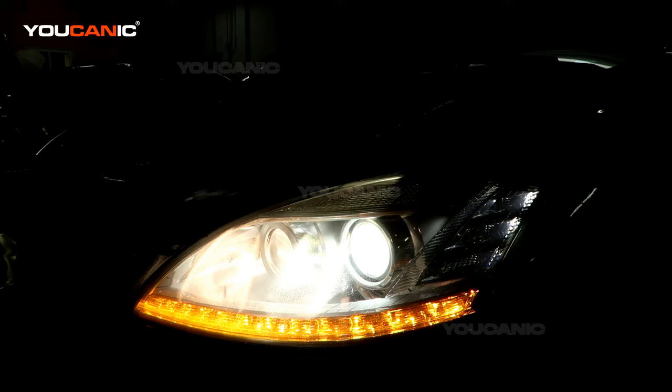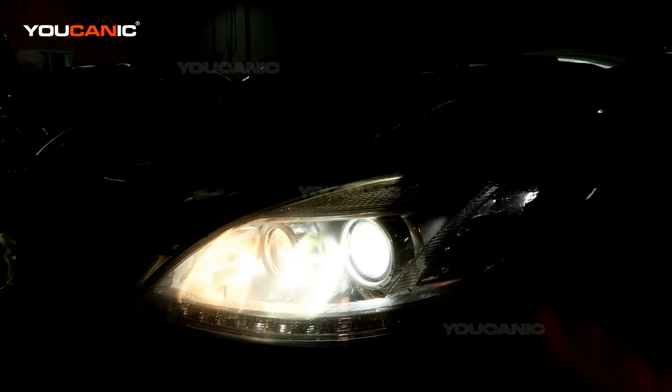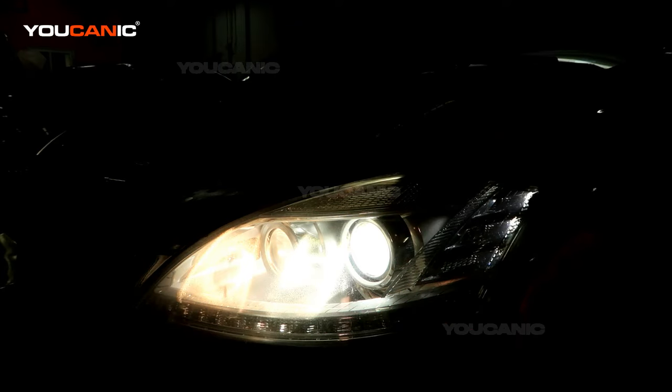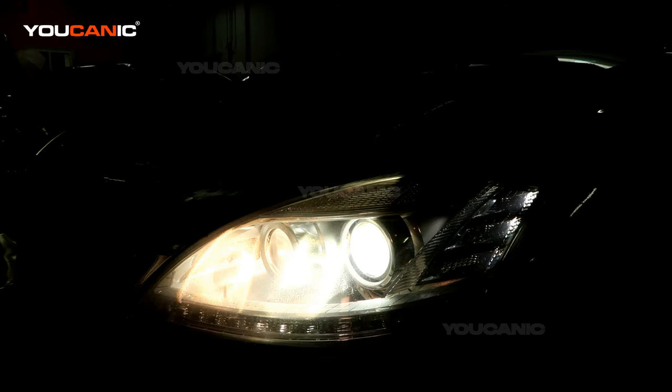And that's how you replace your headlight assembly and headlight itself, or the light bulbs, with removing, just kind of moving the bumper away, removing the whole headlight assembly, turn it around, do what you got to do, put it all back in. I find that a lot easier than trying to make your hands small and reach behind all that stuff.